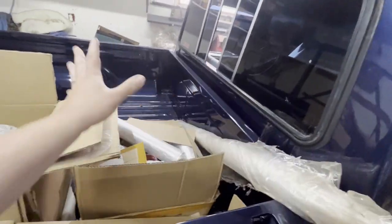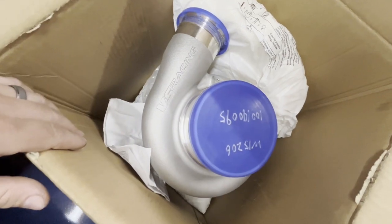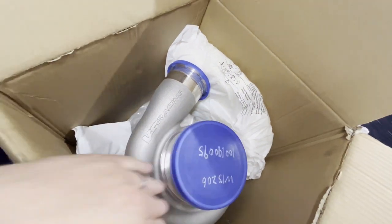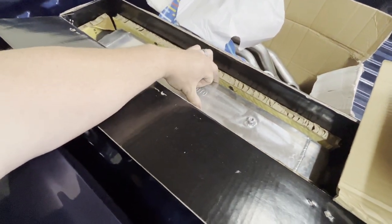The customer purchased a lot of his own parts. I think Competitor's Edge helped spec out a lot of things, and I trust their judgment on that. We've got a box of miscellaneous aluminum tubing. This is the turbo — a VS Racing 80 millimeter, 134 AR — big turbo, at least for me. The intercooler is going to be one of the big challenges: fitting this thing in there; it's four inches wide and there is not a lot of room up front.